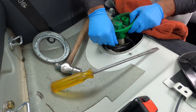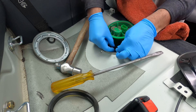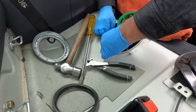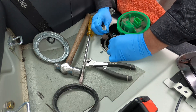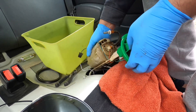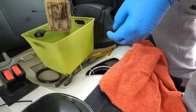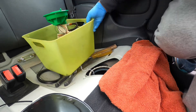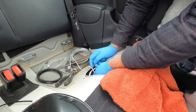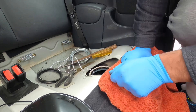There's the connector. Let's get the seat out first — pull it out like that, there we go. Once you move the hoses away from it, it just comes straight out and you put it at an angle and there it comes. Get it out of the car. I actually tied up the hoses beforehand just to make sure I don't lose them in the tank.